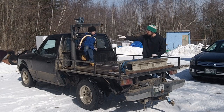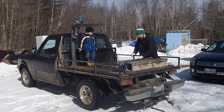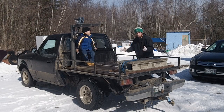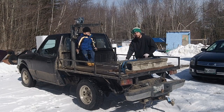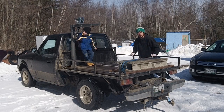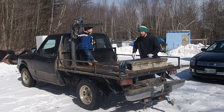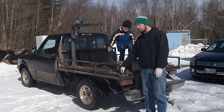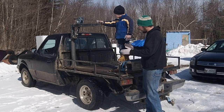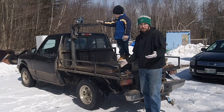You'll notice over here there's all kinds of mud up the side of the cab. The reason for that is I chose to go with boards for my bed. I went with boards because things break, and all I do is take out two screws on the rear and all the boards come out — really quick and easy to get to everything underneath. The problem is boards shrink over time. Along this edge, the boards shrinking opened up a gap, and now my entire back cab gets plastered with mud. I'm going to have to expand the board somehow to cover that gap. Wood shrinks.